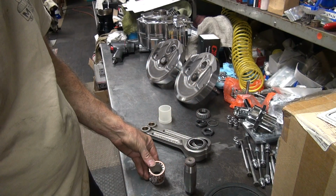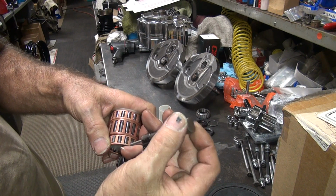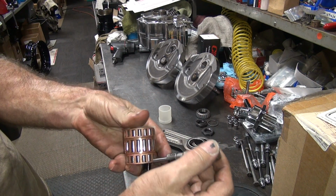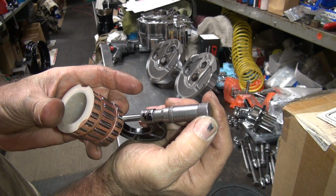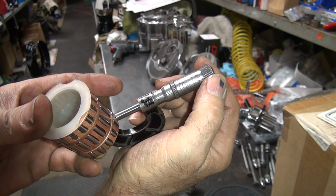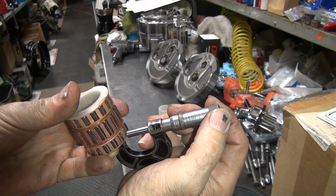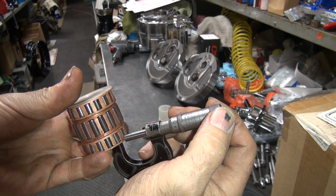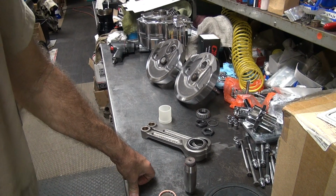So here's all the rollers all clean. Now we got to measure the roller. If I do this just right, I can catch the edge without dropping it on the ground. And the rollers are way undersized too. Great. Yeah, they're at least 2/10 under. Let's see here. It's about 1. It's 1/10. Standard would be 5/10. Yeah, that one's almost 0. It's 1/10. So this is 1/10. So it's 4/10 per side, and that's 8 more tenths. So the numbers are really stacking up as being extremely loose.